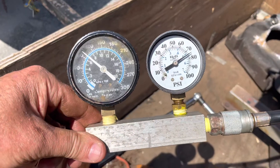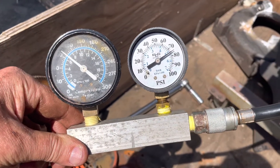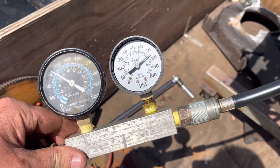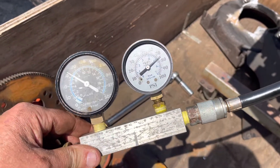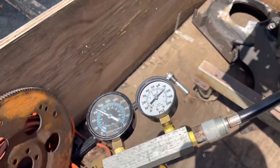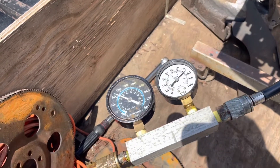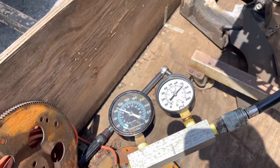This is the result of cylinder number one. I've got 100 psi coming in and about 75 psi on the cylinder, so it's marginal. Number four is the best so far. Two and three failed, and number one is holding 75 — barely there. Number one and three both had good compression, just slight leaks on the exhaust valves.